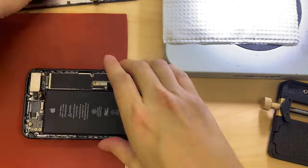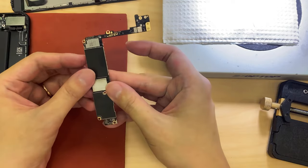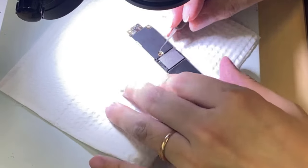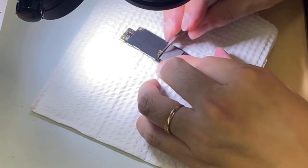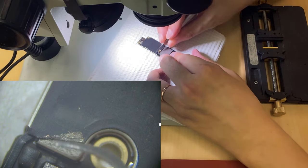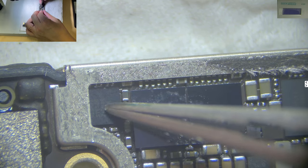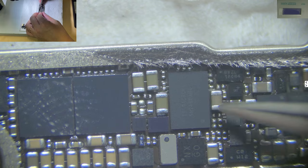So by having these symptoms you're going to check the charging IC, but do not replace it yet until you have proof — the evidence I'll show you now. This logic board has never been repaired before. On the back of the board in the lower part, the charging IC and the USB IC are located there. What we're looking at is the TriStar USB IC and the charging IC. Do not expect that if the phone is unable to charge, changing the battery or charger port will fix it — it could be one of the ICs or one of the components in the charging circuit.